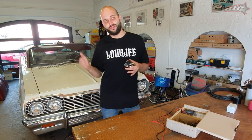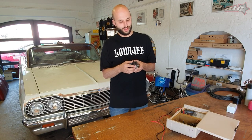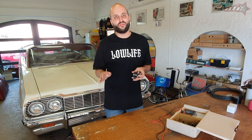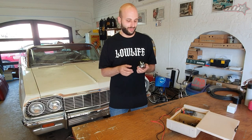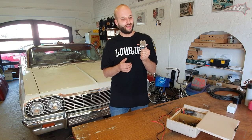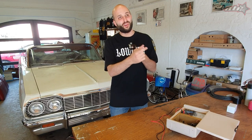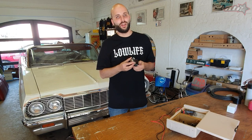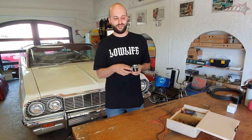If you run on the trunk battery setup — 24 volts or 12 depending on your preference — always keep your batteries leveled up. If you notice they're going low, don't play too much with it or you'll end up with a stuck solenoid and burn stuff up. I'll show you how to measure solenoids to know if they're failing. We usually put two or three in a row so if one fails you still have a backup, but if they all start sticking and you're down to one, it gets dangerous.